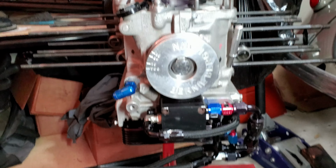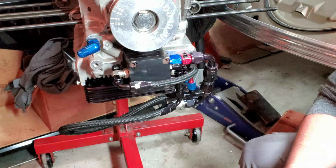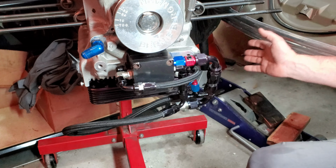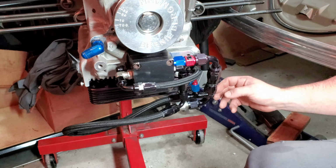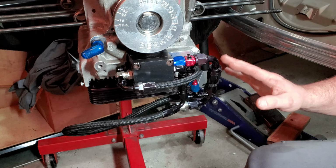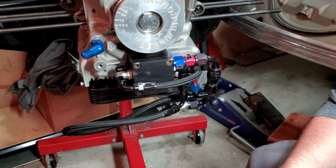Majesty of the Autocraft oil pump. In high power applications, what you want to be able to do is scavenge or pull oil from the outer parts of the engine, because you're putting oil through her so fast at high revs with high horsepower that you have to have a way to get oil to all of the components and back to the engine faster than you would with a stock application.